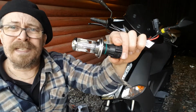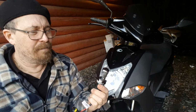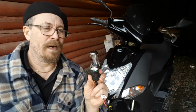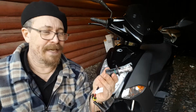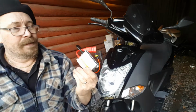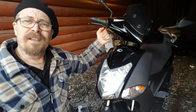And this is a Xenon version that should fit in the hole here. This is 22 millimeter, and be careful if you order something like this that it can't be too wide. Now, this would be Xenon, and it's 35 watts, it's 6000K, and this is the ballast. I'm going to install this in another way, because like I just said, there's no on or off for low beam.